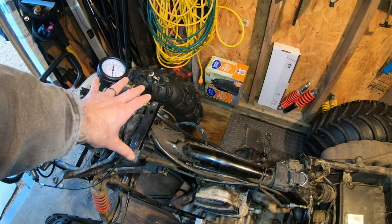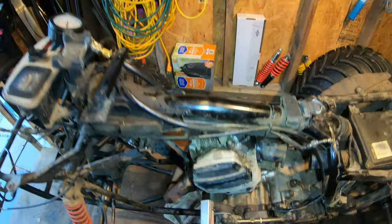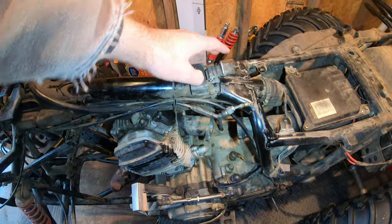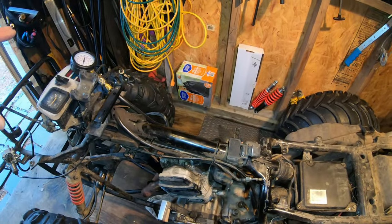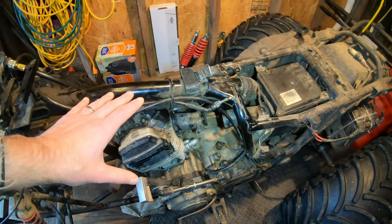There's a plastic cowl back in there. Take off the handlebar and controls, lift that off. There are two screws that hold that plastic cowl — take off the gas tank lid, lift the cowl off. Then there are two screws holding the gas tank, one on each side, plus a rubber snap. Remove the fuel hose from the carb and you can lift the tank off.